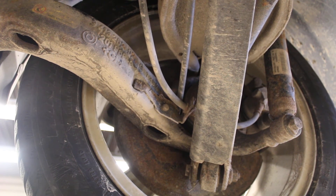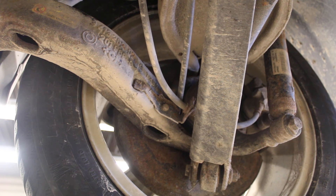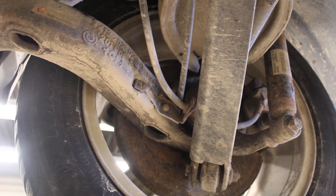That's why on an ABS vehicle when you put your brakes on, you leave the brakes on and push your foot down — let the computer do its thing. If you lift off the brake pedal, you allow all the wheels to release and roll, the computer resets, and in the meantime you've overdriven your braking distance and may not be able to stop in time. ABS is meant to be left alone — put your brakes on and let the ABS computer do its thing.